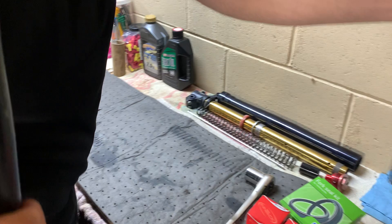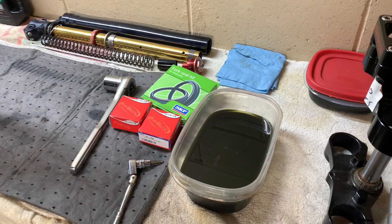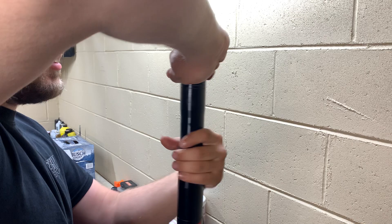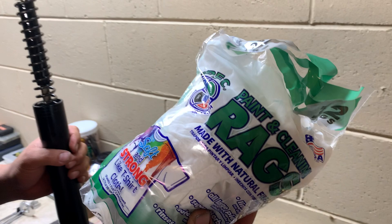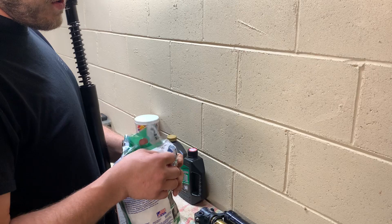You also need an oil bin to drain your oil into somewhere. First step: unscrew your top cap. Don't be scared — it's just a spring and some oil. Get a fresh lint-free rag; go to the paint aisle and get lint-free rags to keep lint out of your oil, your valving, and all that.